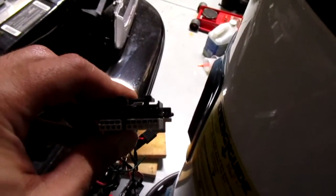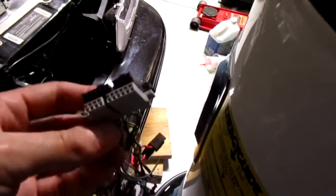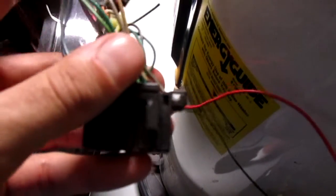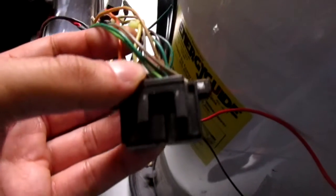That's what you're going to get in the dash — that's going to come out. There might be an adapter harness on that that converts this to whatever the Kenwood unit works with. Or sometimes they just cut the wires right off this connector and look at the wiring diagram. Like light green and dark green — that's one of the speaker wires. You can look it up. I think 12volt.com has a bunch of wiring diagrams for cars and radios, and that's how I figured out which goes to what and wired this thing up.